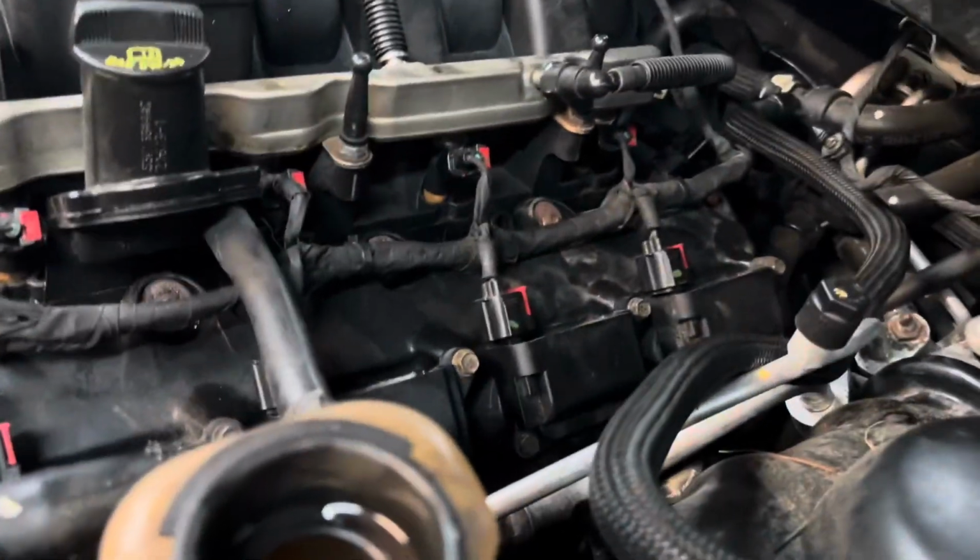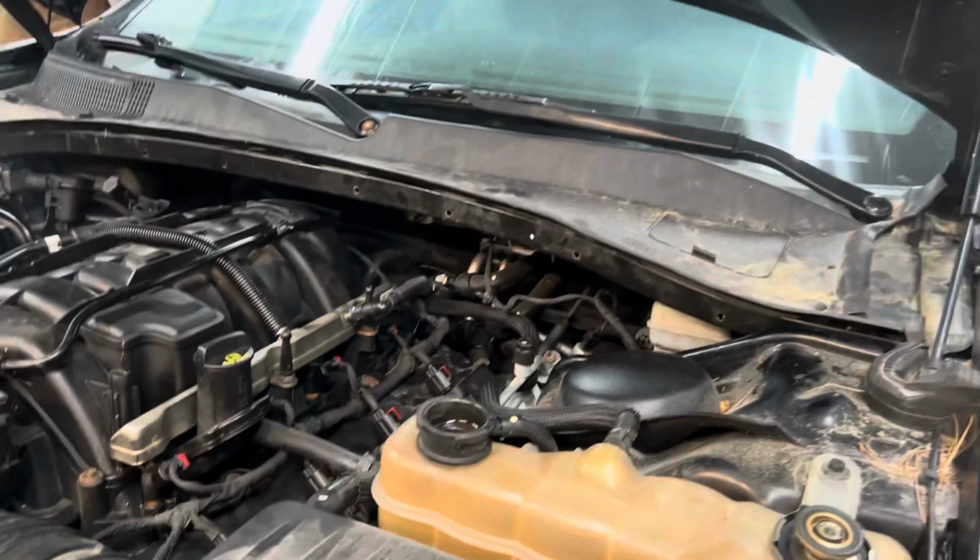It's running really good. Oh, it finally took in some coolant too. Yeah, I'll start dumping in some coolant. Engine work is done. It's running really good. Check engine light even went out after I cleared it, but so far it's out. I wouldn't be surprised if it comes back. I'm still going to put new plugs in it. I did change the oil after, like I said, I started it with the other oil in it, but I've changed it already. Took it for about maybe a mile drive.